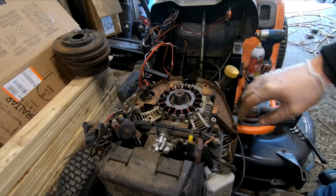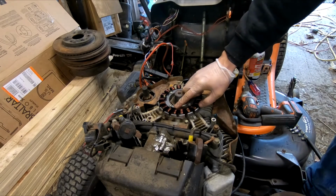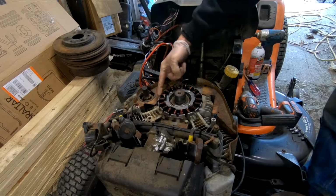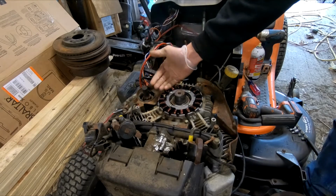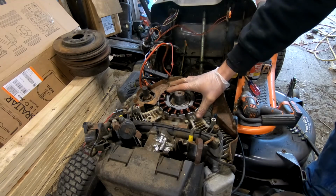And there we are. It's basically that simple. You've got 4 more Phillips to pull out. Your wiring goes through here next to your starter. And make sure that you take the time to fold back this retaining clip that's on this side in order to hold down the wire. Otherwise, it'll come up and you'll hear it hitting inside the flywheel and you'll wonder what went wrong.